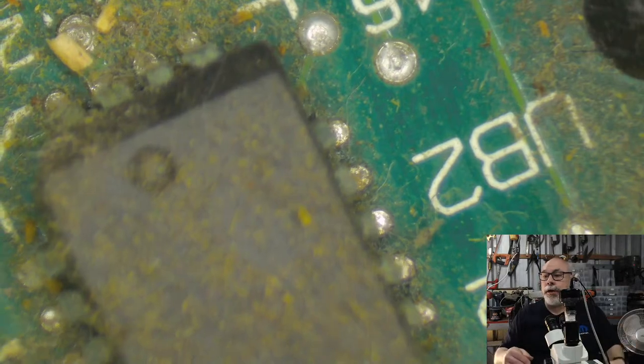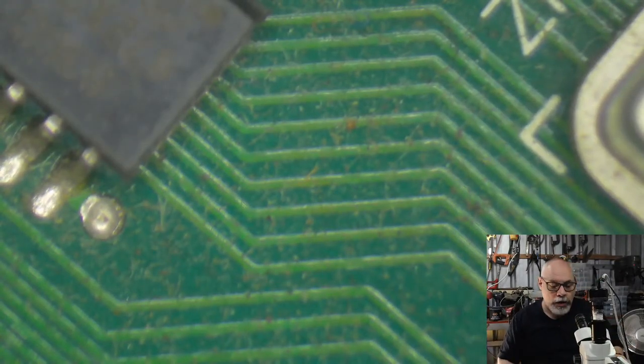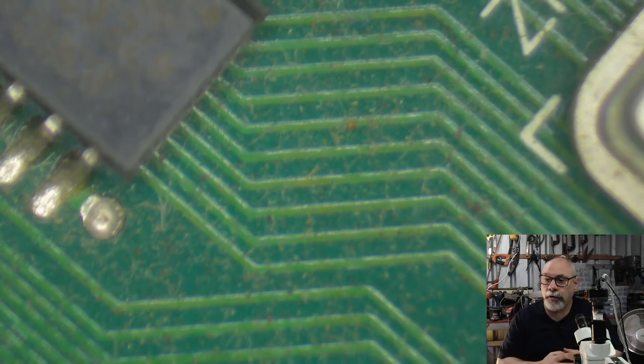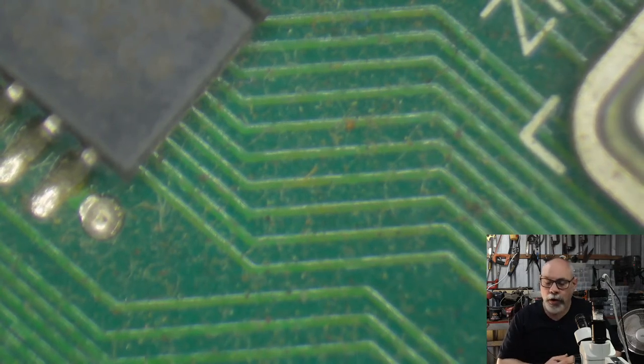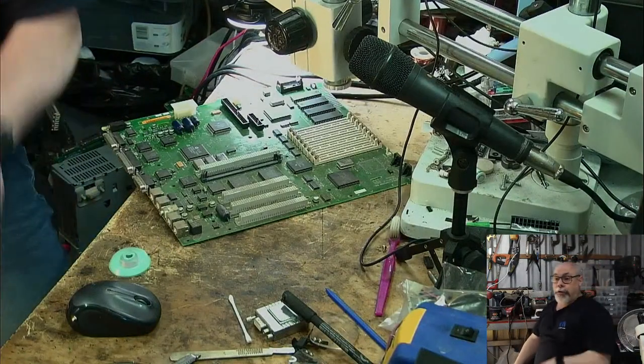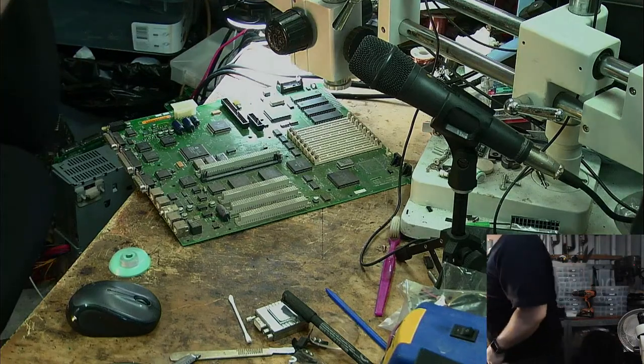And just for anyone playing along at home, these sound chips, there are two of them on here. They're the same sound chips that you'll find on the classic, but there's only one of them on there because it's obviously a mono thing. A classic only has a single audio, this one's stereo. So two sound chips, obviously one for left and one for right. They use the same sound chips on the Macintosh Portable too, actually. And they are interchangeable, so if you have problems with those sound chips and you need to replace them, I'm pretty sure the classic, let me just check, if you've got a 2CI and your sound chips are gone for some reason.